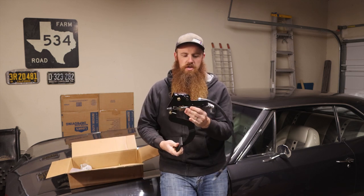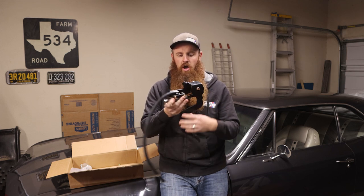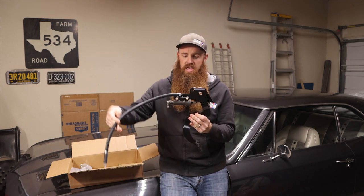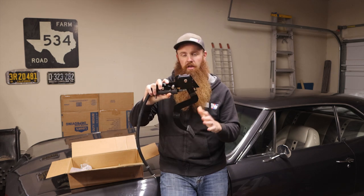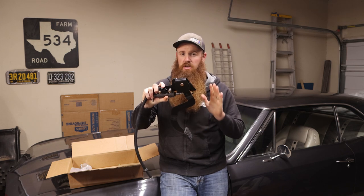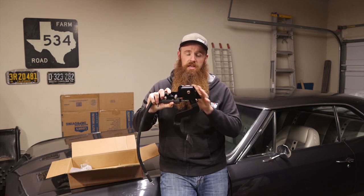So here it is. This is our newest, and you can see it's a complete assembly. It actually already has the clutch master cylinder mounted on the pedal assembly itself. It already comes with the hose. The beauty of it all is that you bolt it in and all the geometry is correct. It's not going to over-stroke this piston, it's not going to under-stroke it. You're going to have a nice, perfect pedal setup every single time when you use our bracket.